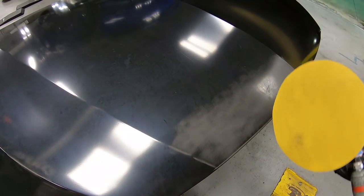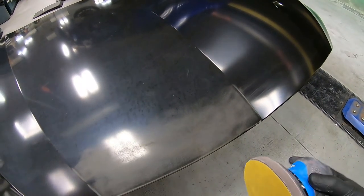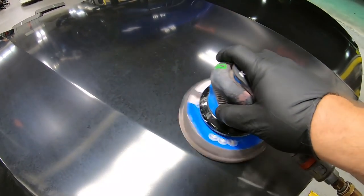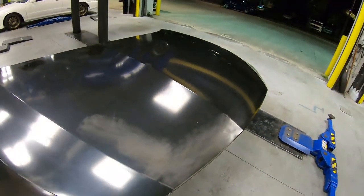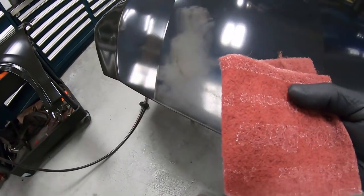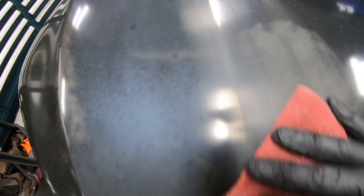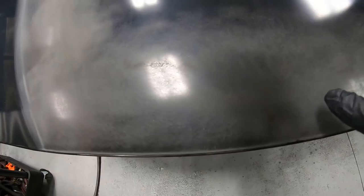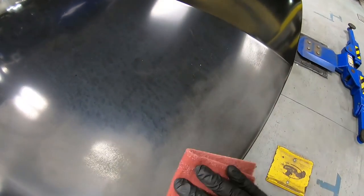How do you know when to stop? There will be areas where we might go through to the aluminum, but we want to try to avoid that as much as possible. So when we go to sand, we'll kind of stay off that edge — we can always come back with our maroon scuff pad and just pick up these edges like this. We'll get a nice dull finish. You can see there are a few areas that are a little shiny, and we can come over it with the scuff pad since it's more rigid and goes deeper into the grooves rather than a flat piece of sandpaper.